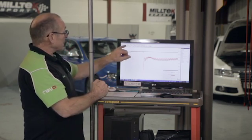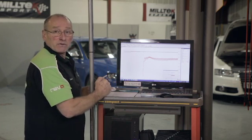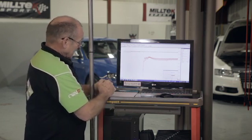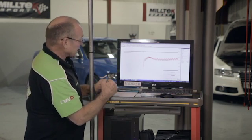Because I've left the scaling as voltage, it means that when I finish that current measurement, I go straight back with my voltage probe and can carry on doing voltage checks. For me, it's about speed. So, that's an enormous amount of current. Does that mean the consumer — the starter motor — is faulty? Not necessarily. Is the engine cold? How viscous is the oil? How much physical work has it got to do in turning the engine over?